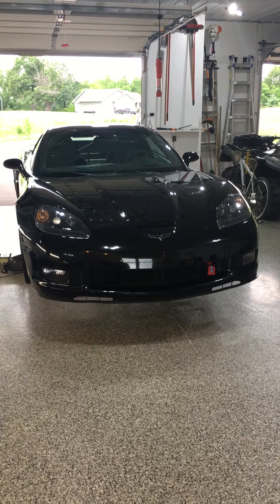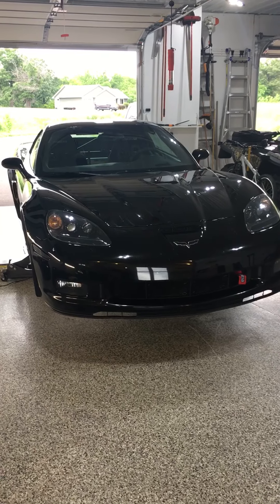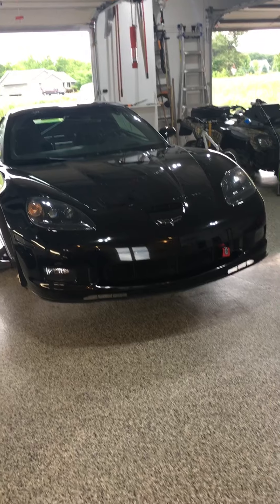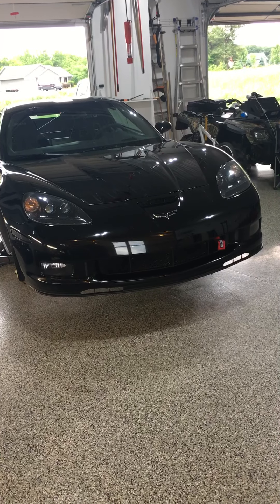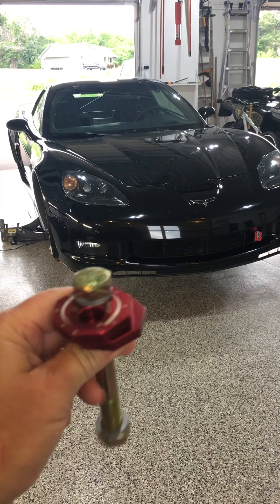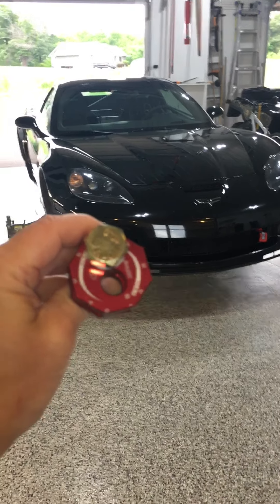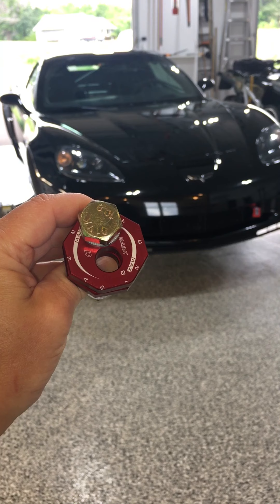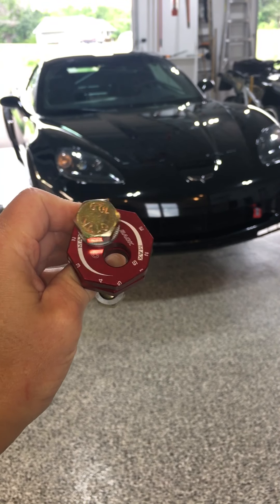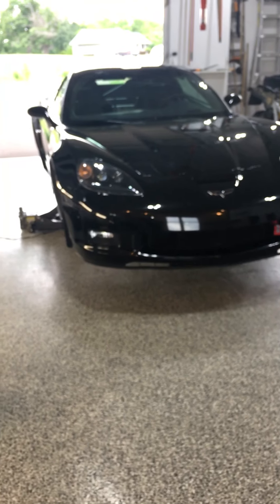I also decided to do some AMT mono ball control arm bearing and bushing upgrades, which led to a slippery slope. I figured if I'm going to have good suspension, I might as well have better alignment as well. So I'm also using these AMT eccentrics — they lock into the aluminum cradle and prevent the alignment from slipping under hard load. If you're running really sticky tires, it's important to have and super easy to adjust. Looking forward to getting these on.